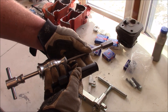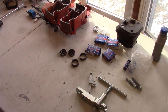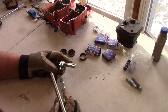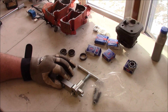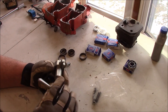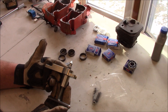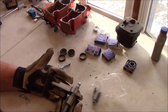That's the Blind Hole Bearing Puller Kit from Harbor Freight — $75. Obviously something you want to have if you're going to play this game. It became apparent to me that I was going to have to start pulling apart a fair number of 562 Husqvarnas, so I went and bought this Husqvarna shop tool — this is a case splitting tool. Instead of the big C-clamp that I used on the 372 series, this is the kind of thing you have to have for the 562s. These really aren't that expensive — like $50, $60 — but if it's going to be a saw you plan to work on, I highly recommend getting one.